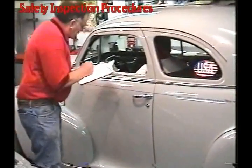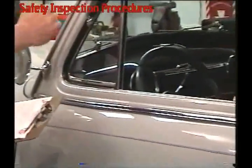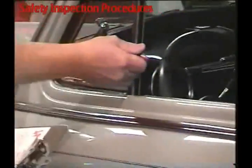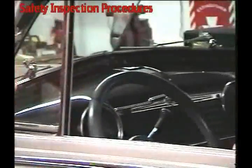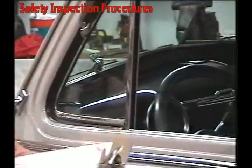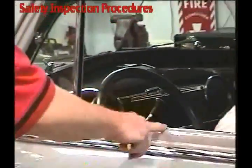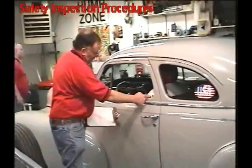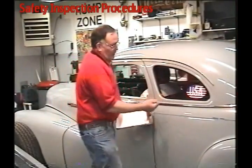It's got safety plate in all the glass. I put a pencil up there and I'm looking for a double reflection in the glass — you'll see two pencils if it's the right glass. You want to check all the windows on the car. You can see that it's not cracked — you're getting reflection off of it, all the way around the car.